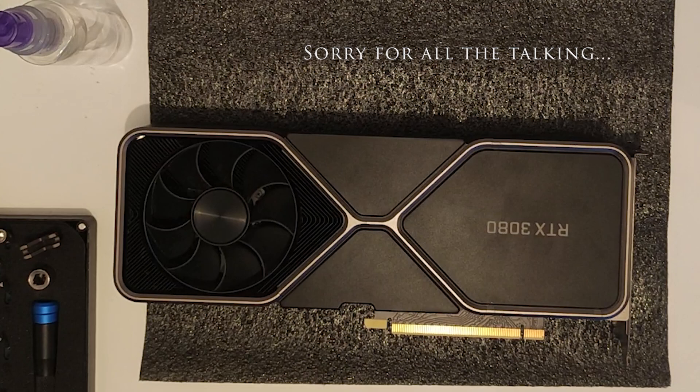The card coming apart today is my personal RTX 3080 FE, and not because I want to see what's inside but because I honestly have no other recourse left. I thought I had managed to sidestep the dreaded memory junction temperatures and for the better part of three months that was the case, until last Friday. Out of nowhere the fans went straight to 100% and the game I was playing started to chug. Quickly checking the temps: core was 60C, core hotspot at 77C, but memory junction was a blistering 110C — it had never gone above 94C in gaming for longer periods, still a lot but on the safe side of the GDDR6X spec.